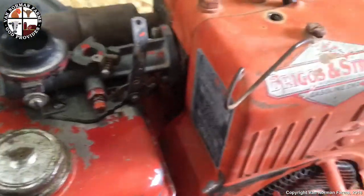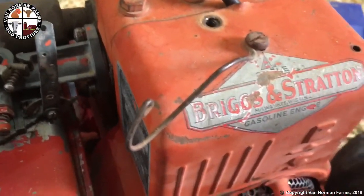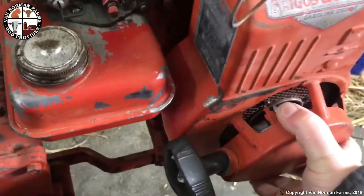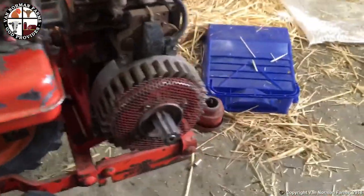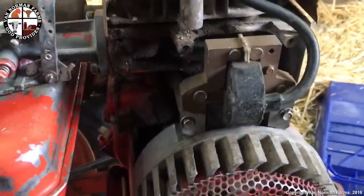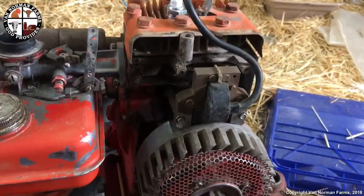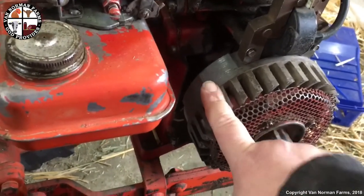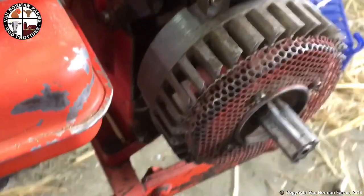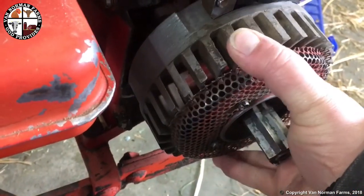Well, we found out together, because they didn't know, that this particular really old engine, you can't just directly switch it over to an electronic ignition, like this newer model electronic ignition here, electronic coil. And the reason you can't do that is because apparently you have to, according to Briggs & Stratton, either replace the flywheel with a modern flywheel or repolarize the flywheel, the magnets in the flywheel. So yeah, that's not gonna happen, so